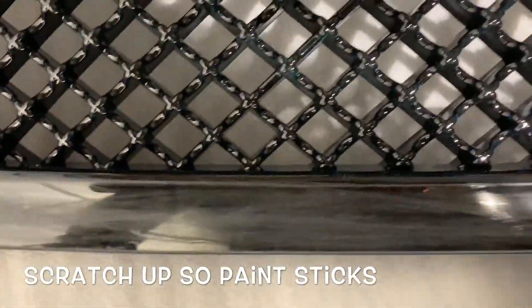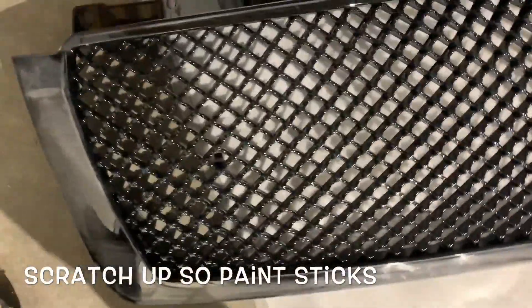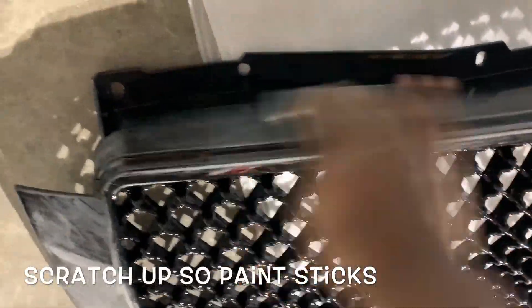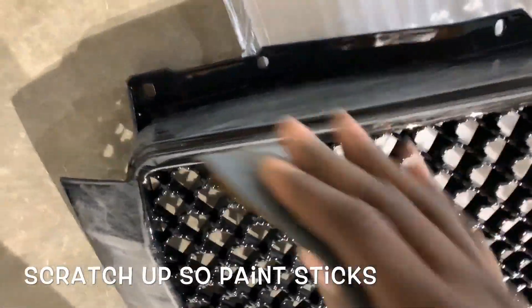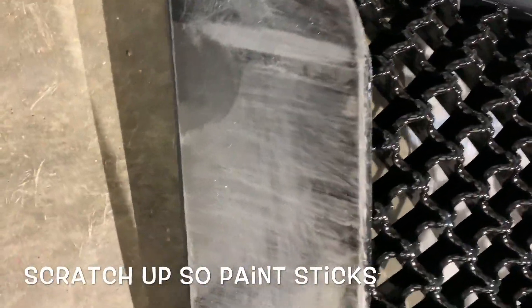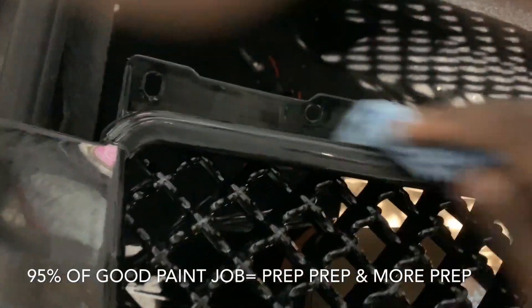It's already started — you don't have to do much, just rough it up a little bit. Don't be too scared, because the primer is going to fill in any of the scratches. If you're going for perfection, go ahead and do 1000 or 1200 grit afterwards to make it smooth, but I've done this a couple times and it turned out pretty good. Now I'm wiping it down with isopropyl alcohol to get the dust and dirt from sanding off, and I'm going to put my first coat on.